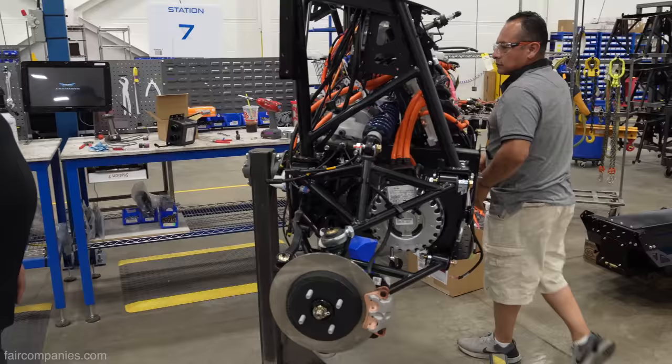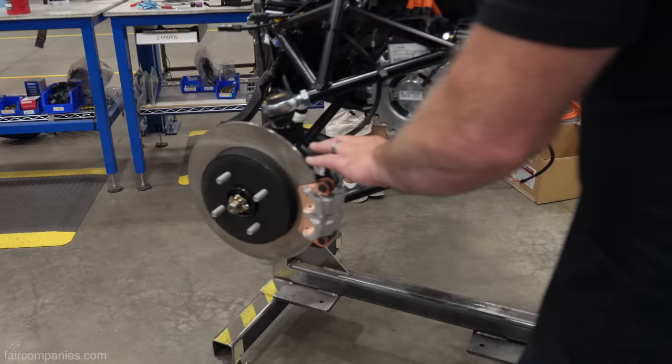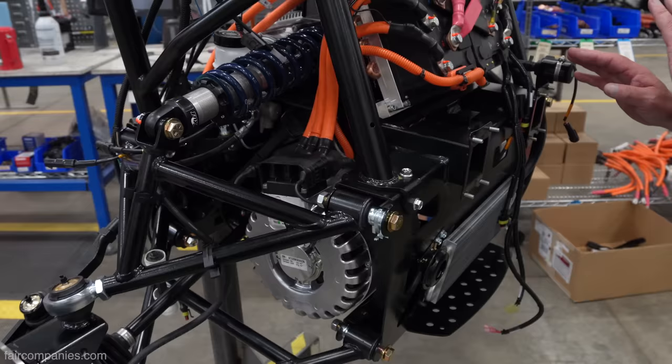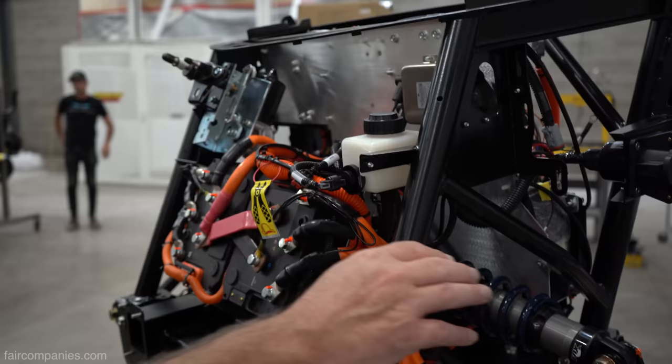This is the lion's share of a vehicle. You have front-wheel drive, three-wheel disc brakes all the way around, CV joints and a sway bar right there, two inverters — one for the right and left motor — a chill plate in between, and the charger right behind it.